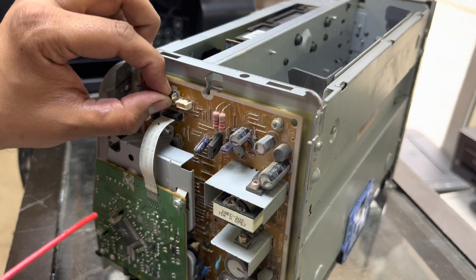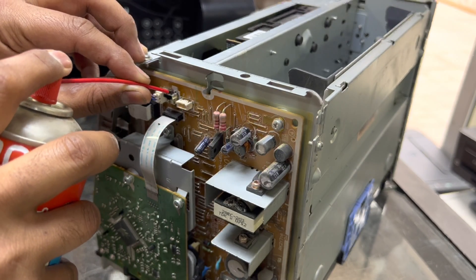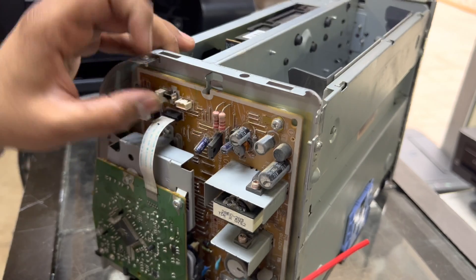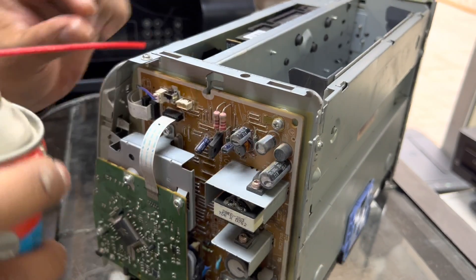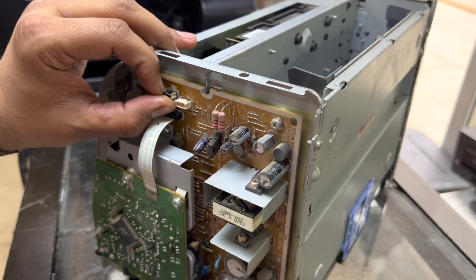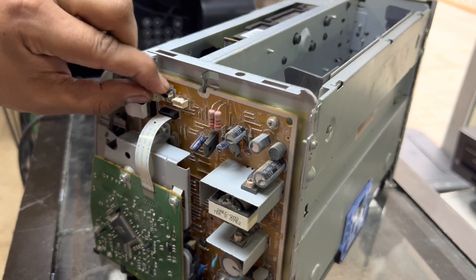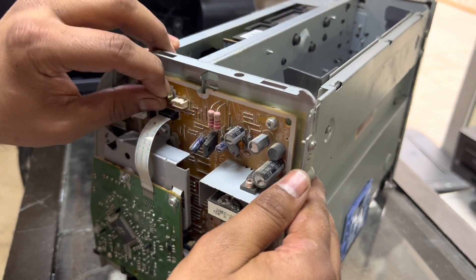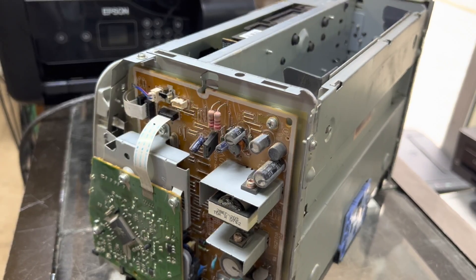Put a bit inside, then press this button continuously until the lubricant reaches inside the button. This will remove any dust or carbon inside the button. Apply a small bit amount again, then a bit more again. Now the issue with this button should be fine. We will clean it with a tissue and then check.